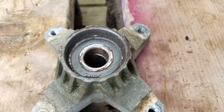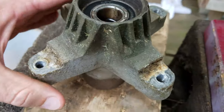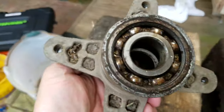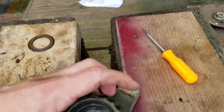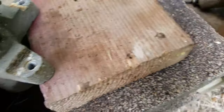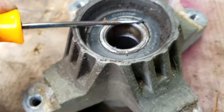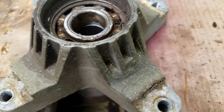I've decided not to put a zerk in here. As you can see there is no zerk on this thing. On this side I popped the shield off already, so do the same thing on this side. It's pretty easy — you just get a pick, preferably a clean pick, and go right between the metal underneath it and just pop it right on out.